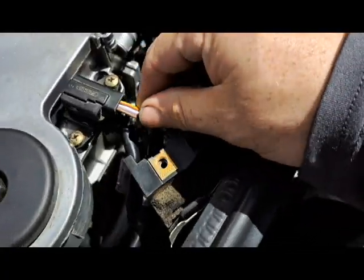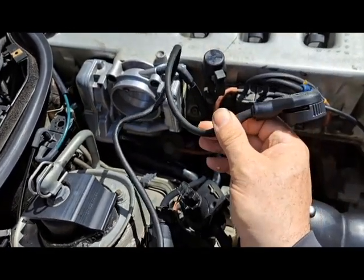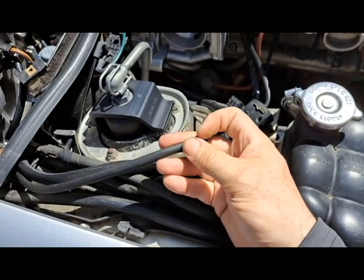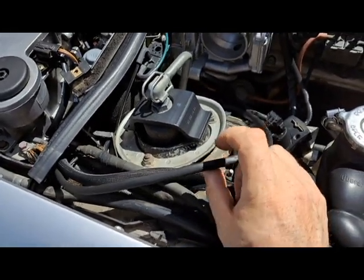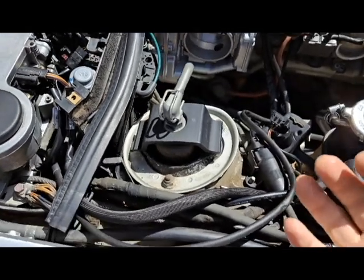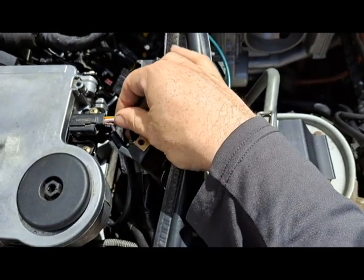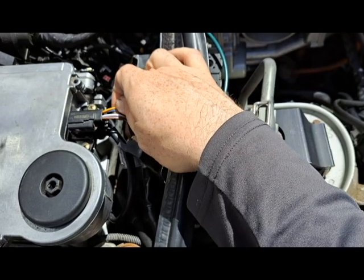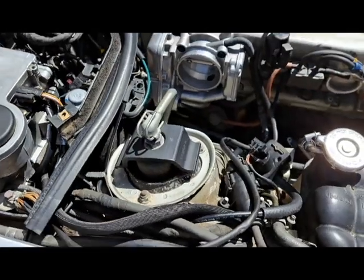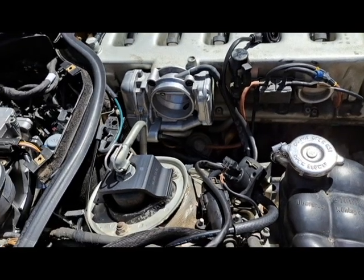The wire I used is around 16 gauge, taken from short ends from another project — the factory MAF sensor wiring harness kit I did a couple months ago. These are all originally biodegradable wires, but on the kit that Mercedes sends you they give you a lot of extra wire. It's really high-grade, 200-degree Celsius military-grade wire. That's a little trick: if you're looking for some wire, the MAF kit comes with blue and brown wire, and I just used a red one to substitute for the green wire, which goes to the oil pressure sender. If you're doing your MAF sensor, it's a great way to go — it's real Mercedes wire.